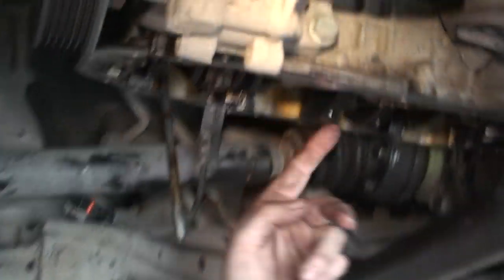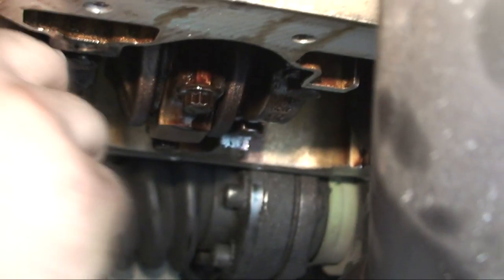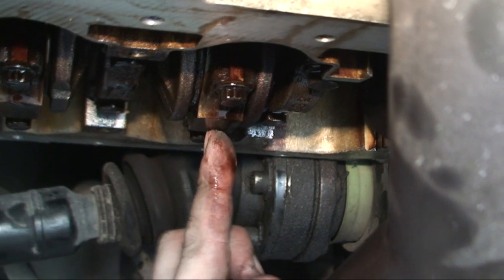What we need to do is get these two pistons down. We should actually be able to turn it by hand — I've got my hand on the bottom crank, the fan belt's off, and you can turn that by hand. Another good thing to do is once it's up there you can actually just check these again. I've just turned that by hand. That's the worst thing — you can hear that noise on this one. That one's jammed again. But the other two are not doing that now. So again, mark it with the arrow, take them down, put them up — job's a good one.